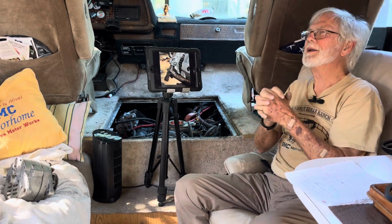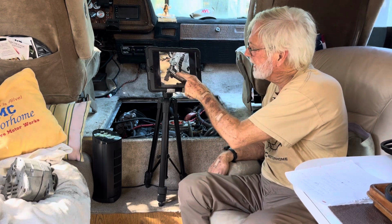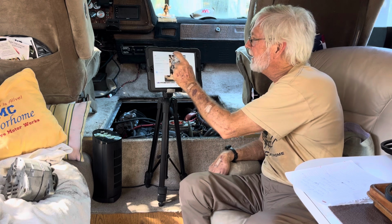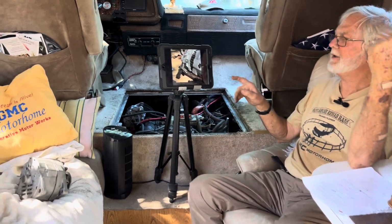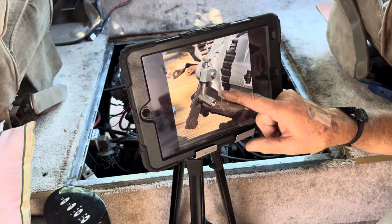Plus, you know how you go to tighten the alternator and you shove a pry bar in there, hold it up and tighten the bolts up and stuff? Well, Chad came up with something, and I would officially call him a steely-eyed missile man. He's got an adjuster bracket here. You use a half-inch wrench. I'll show it to you when it's in. You put this little bracket that he came up with into it. He set up this little bracket adjustment here. It's got this cute little bracket he machines and this stud, and he makes an adjuster. Fantastic.